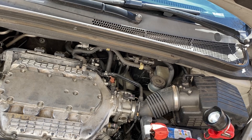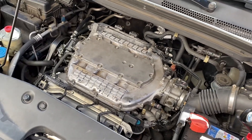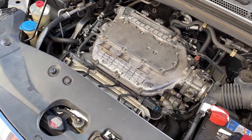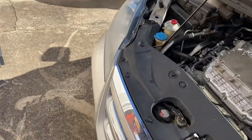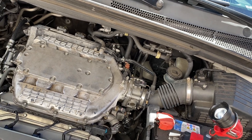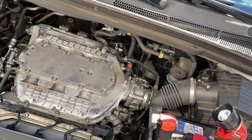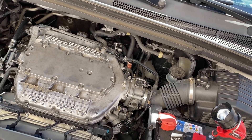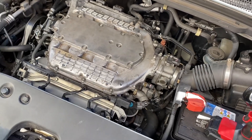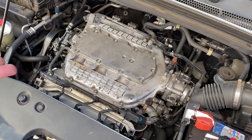You can buy an aftermarket add-on called an SVCM controller or VCM muzzler. What it does is it disables the car from running in three-cylinder mode, so it runs as a V6 always, all cylinders firing — at a cost of maybe one to two miles per gallon — but it supposedly will not burn as much oil.